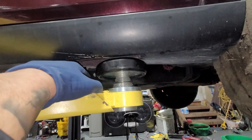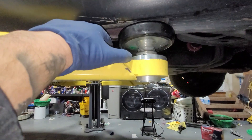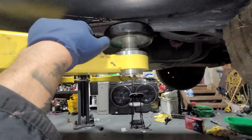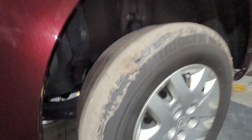I do not recommend jacking it up from here — this is not a proper jacking point, this is only a lift point with a post. Worst case scenario if you can't jack it up there, just know that over time these spots get destroyed and weakened, and it'll weaken the metal right there.